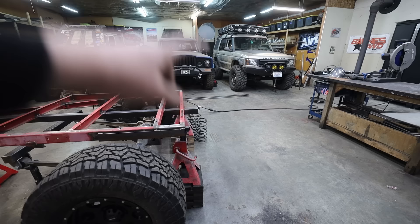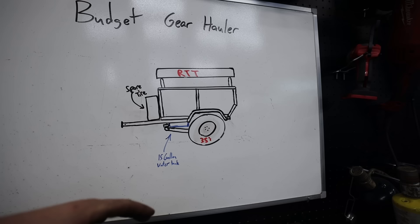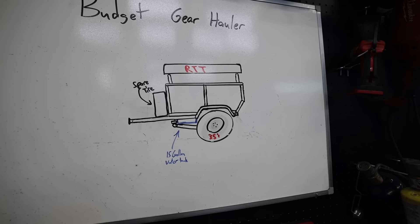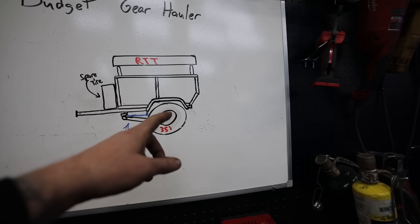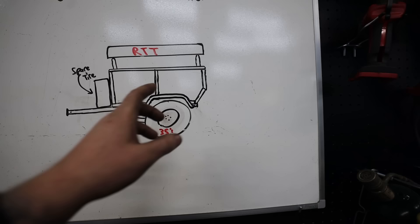The footprint of this trailer right now — the lower deck — is about 56 inches. We're going to come up at a 45 and then go to an upper deck that's going to be six feet. I put together a rough drawing so you can see the basic plan. There's going to be a whole bunch of things that change, but this is the basic idea. We're going to have a 15-gallon water tank. I want it nice and low because people roll these off-road trailers all the time and I don't want to be one of those people. So I want lots of weight down low — even though we sacrifice a little ground clearance, it'll still be higher than the rear axle. Then the back goes up at a 45, and the upper deck is six feet.